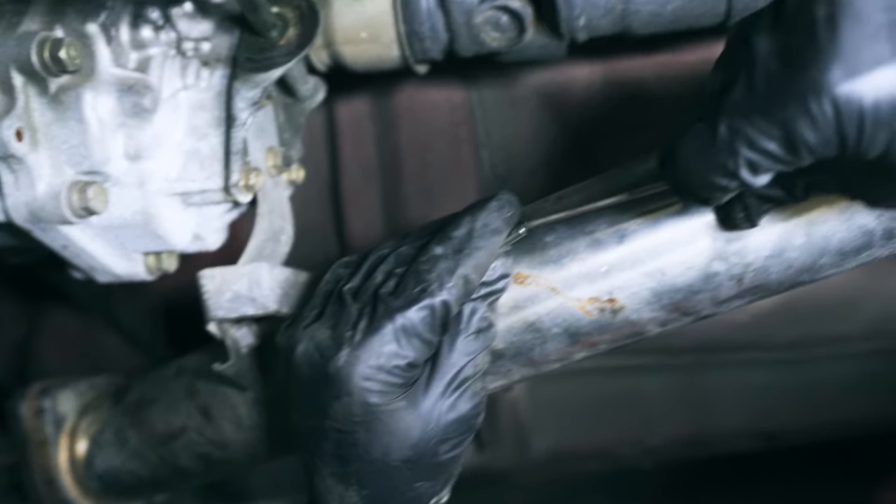So now the rubber boot is removed. This is the boot that sat inside — your shifter goes through that hole. Ended up not removing the boot from the shifting arm, so I just dropped this down below the inside of the car and pulled it out as one piece. So this is what we were talking about — all the play. In every direction, this thing is just shot. All sorts of play. This thing was just introducing left, right, up, down slop — and all the blue stuff you saw is just the bushing completely disintegrated.